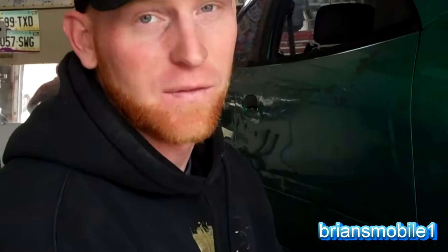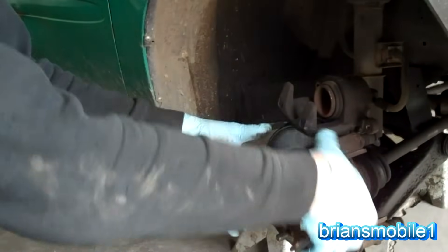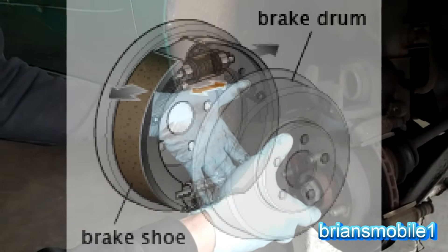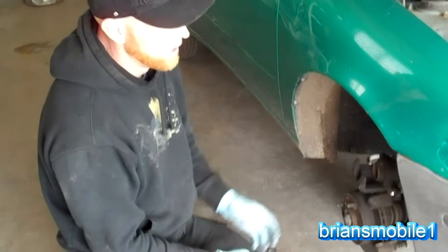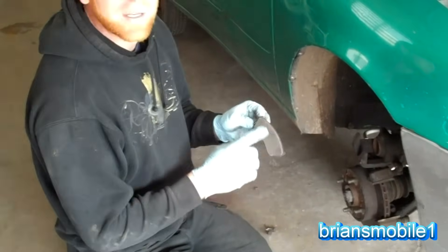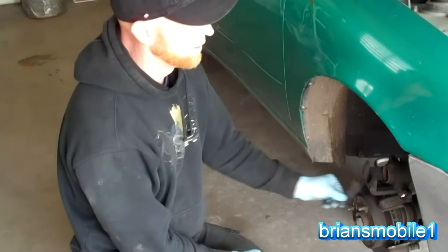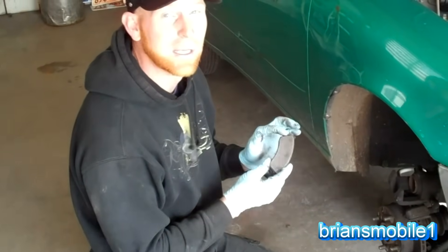So that's what that noise is. Sometimes when your brakes squeak, it's the indicator and you need new brake pads. Other times it's an excess of dust. These are disc brake rotors — disc brakes have a disc shape, while drum brakes are like a big popcorn bowl with curved brake shoes that go inside. Drums don't let dust out so well and are very prone to squeaking, so maybe you just need to clean them out with brake cleaner — put a pan under it and spray after you pull the drum off. If you have disc brakes, it could be that they're glazed — maybe you were driving in the canyon and used the brakes instead of downshifting, and they became so hot they turned to glass. Glass on metal is bound to squeak, but that will wear out over time. Often times, though, it is the indicator squeaking.